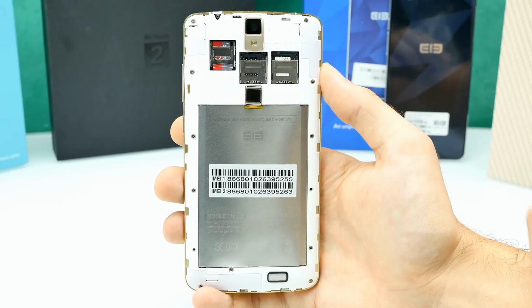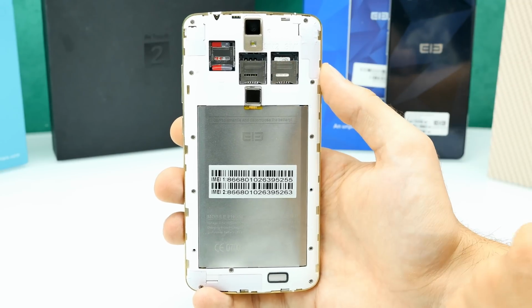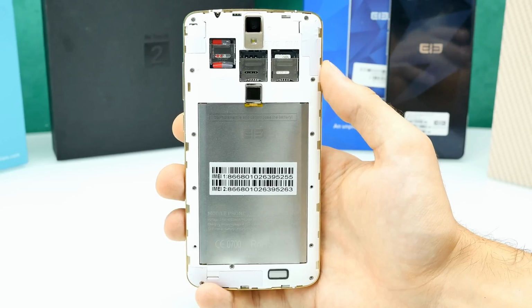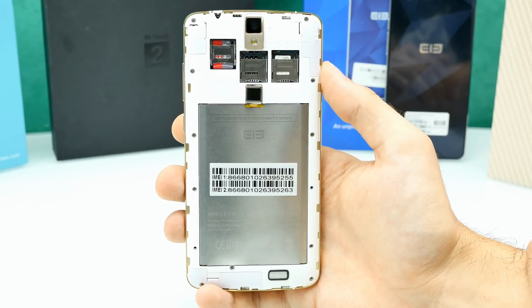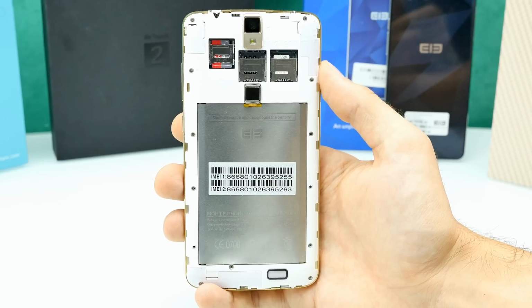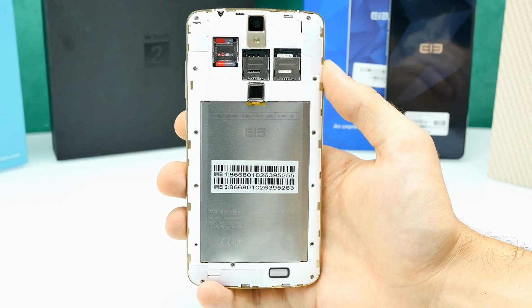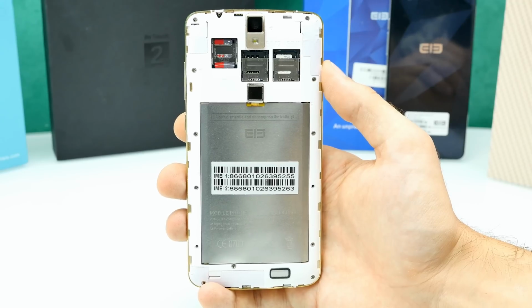First of all, SIM card slot 1. I'm currently using a nano SIM card, but it actually takes micro SIM cards. So if you don't have a micro SIM card or nano, you have to use an adapter. Then here we have SIM card slot 2. And yeah, the second SIM card slot supports, for instance, GSM quad band. And the first one supports LTE, 3G. You will see all the frequencies later, and you can also check them out on efoxshop.com, so in the datasheet.